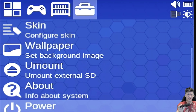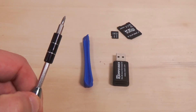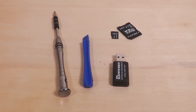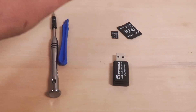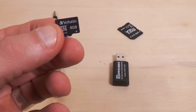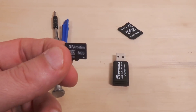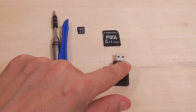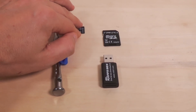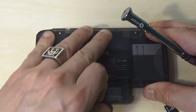That's a quick run-through of the menu. Now let's get to actually installing it. Before you start this project you'll want to have your tools ready. First you'll need a small Phillips head screwdriver to unscrew the back of the unit, and a spudger to help pry the unit open without damaging it. You'll also need a micro SD card — it does come with one, but bring your own so you can keep the original. I recommend 16GB or higher. You may also need a micro SD card adapter to get it into your computer.